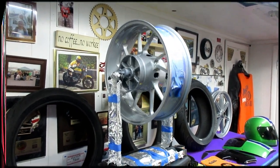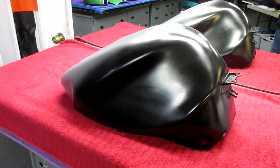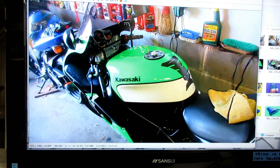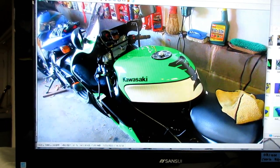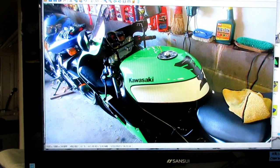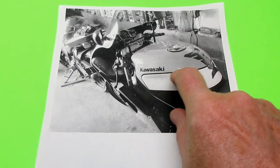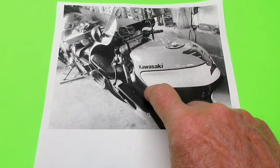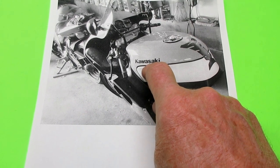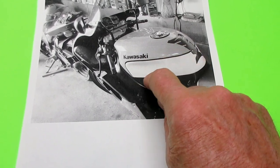Today we have to back-mask off what's going to be white on Luciano's ZX7R tank. This is basically the paint job that Luciano wants to replicate, except he's going to put his own stickers on and not use the Kawasaki wordmark. The original paint job had a piece of tape placed as a stripe — I'm trying to see how far above he put it. It runs parallel to the bottom, about a quarter-inch above, so this will be easy, and then we'll break it in half.